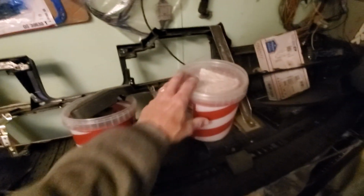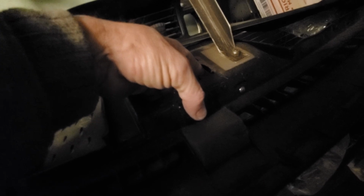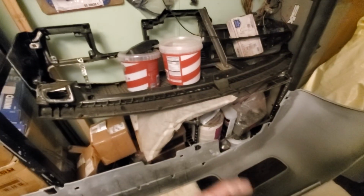There's 3 bolts. There's a bolt in the end. There's one bolt in the center. You can see the bushing that I put in there, and that's super thick. It's like an inch thick, full of chopped fiberglass, and then it's got inserts in it. And down on that end is the same way. So there's 3 bolts holding it up with these braces, with one brace running to the firewall. That's it. I can take my dash off to work on anything behind the dash in 5 minutes. It's 1, 2, 3, 4 Allen heads, and it's off in your lap. That quick, that easy. So all right, I just wanted to get you in the room.